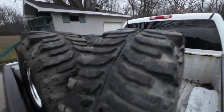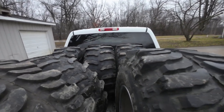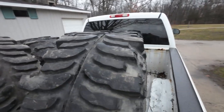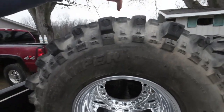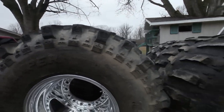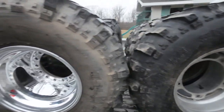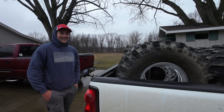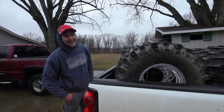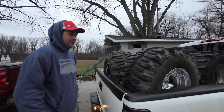What do we got going on this morning? We're going to get some dune tires cut - the boggers. Kermit's got 235s, we got 433s for the LS Js. They cut the sidewall out, scoop the tread, take the meat way down and throw some roost. We're getting set up for dune season - they're all on five-wides. We run adapters to adapt into our lug pattern. It's a really light setup and they throw a lot of sand - they hook up good. We got them all loaded up, heading down to the Michigan-Indiana border.